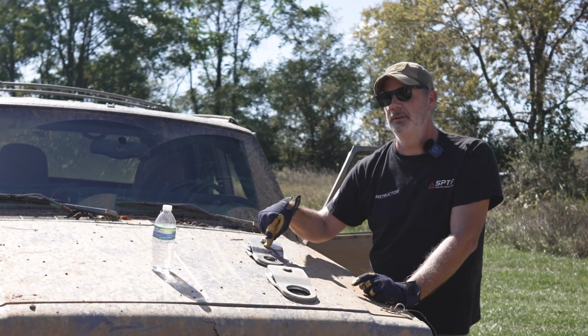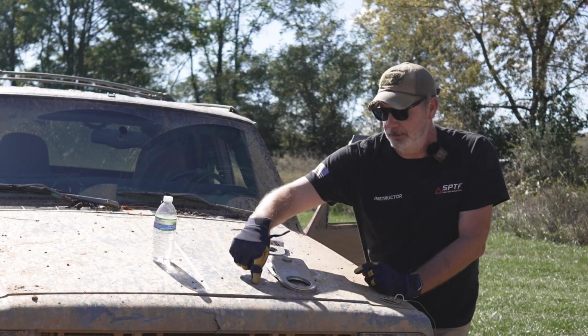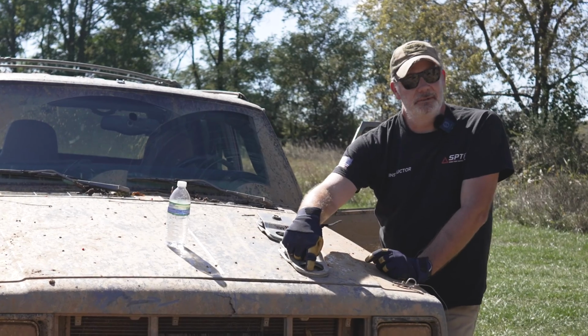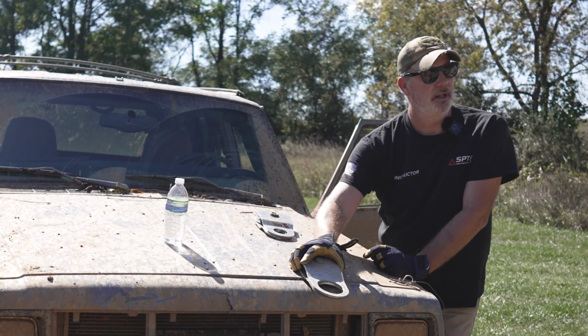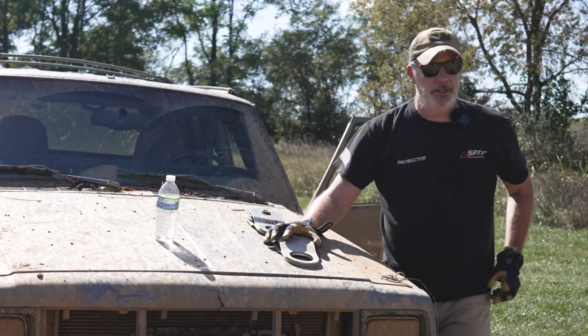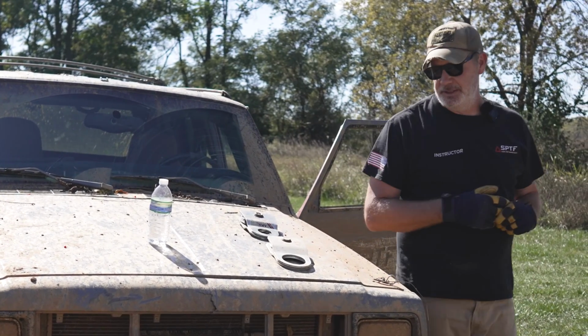Run the line up under the truck. Yeah, so I run a line out to a tree or something out here, and then terminate on this vehicle. And I can winch him forward all I want, right? And I can keep doing that as much as I need to. So you can get pretty creative with the snatch blocks.